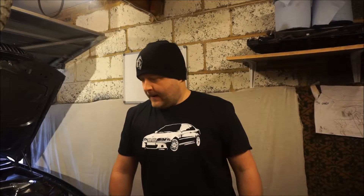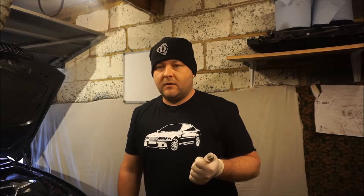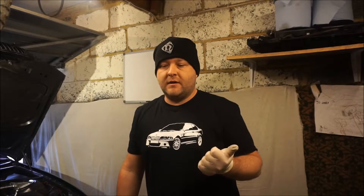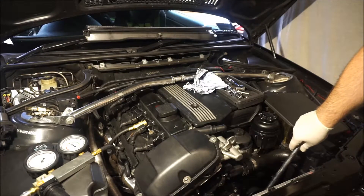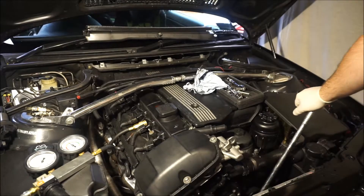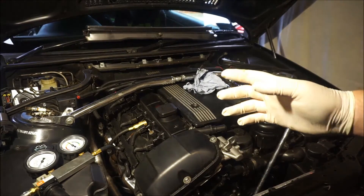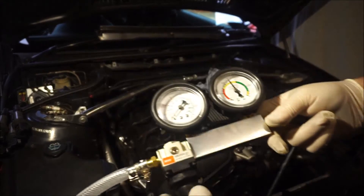Don't do this with a cold engine - there's no point. Always use a warm or hot engine. I'll explain the bad way first - how to mess up this test - and then I'll explain how to do it correctly. First of all, you need to remove all the spark plugs. Then you need to gain access to the crankshaft, put a long bar on it to rotate and get the piston into the best position, which is top dead center.